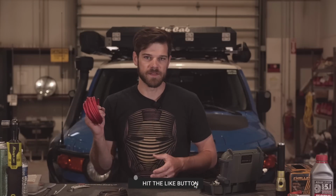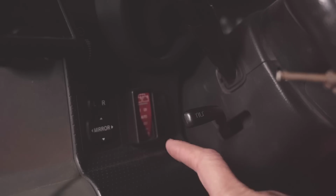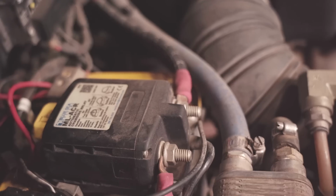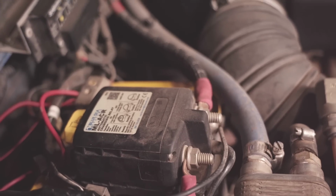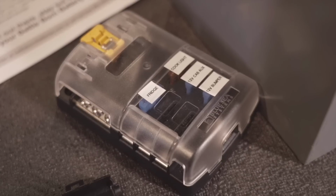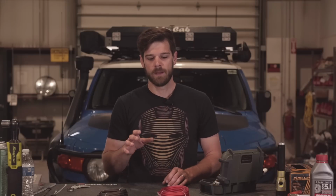10 years ago when I bought this FJ, it was basically you buy a Blue Sea 7622. They're really overbuilt for our use. They're built for like houseboats and stuff. And you get two deep cycle similar batteries and you charge them together. You can winch together, do all that. Blue Sea is the same guys that make these fuse boxes that everybody uses. And these are awesome too. They make really nice stuff, but there's a limitation to what those dual battery systems are good for.